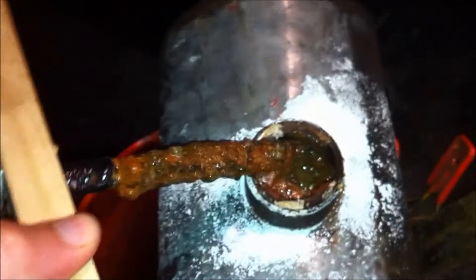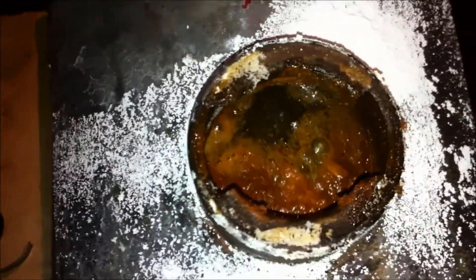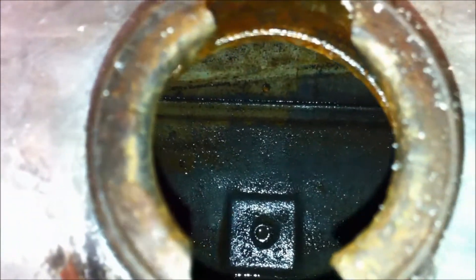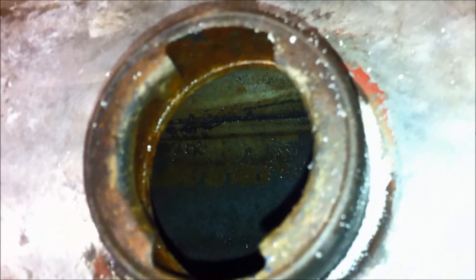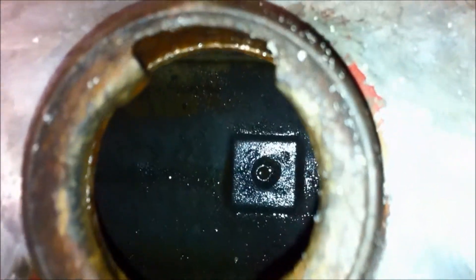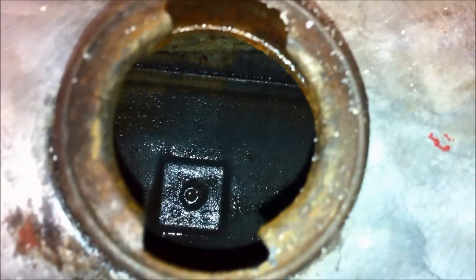This thing has been going for 24 hours inside the gas tank. I just pulled the power cord — let's pull this out and see what we got. Oh yeah, it got a lot of crap out of there — that's awesome. Here's the inside of the tank. I just poured out the solution and haven't even rinsed it out yet, but you can see it looks like bare metal pretty much. The little bit of orange stuff just wipes right off with your finger — it's just sludgy stuff. This electrolysis is really awesome.